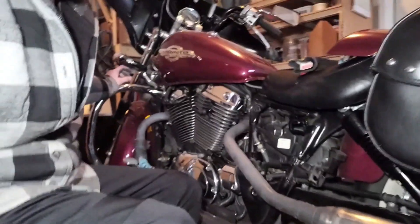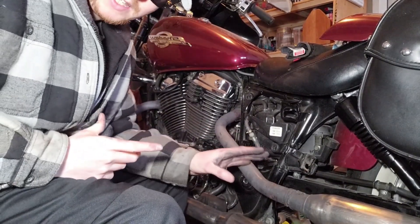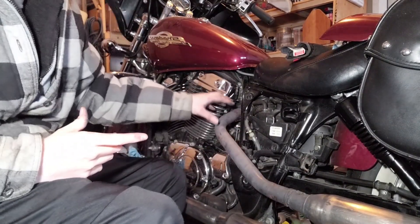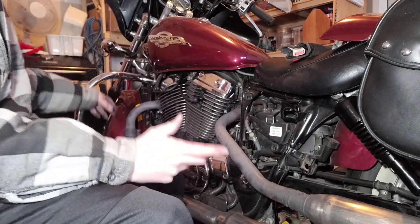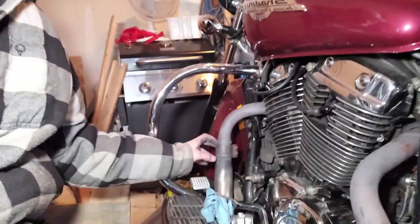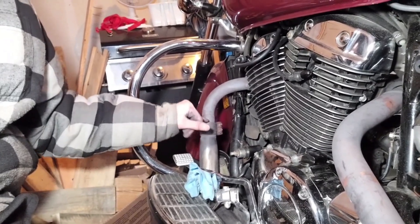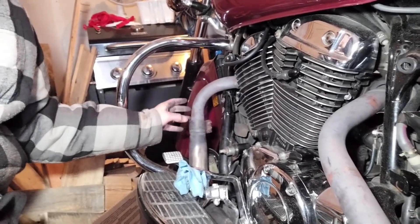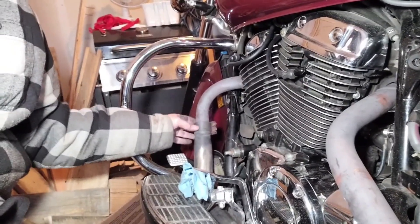What I really want to do, before I get it painted, is get the bike started. I'll get the gaskets in, get it started, and position it where it needs to be. You can see here there's a bolted-on collar — I want to get it lined up to where the exhaust needs to be and weld that, just to get rid of that entire collar.